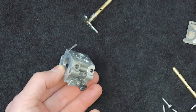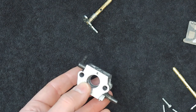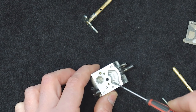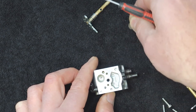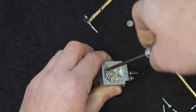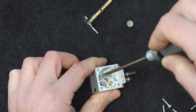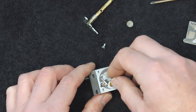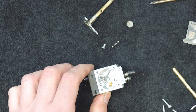What I'll do is bore these out and fit some bearings in there - I'll show you how I do it. Not sure if it's a DIY job but we'll see - you guys be the judge. We'll pull that inlet screen out using a small screwdriver - it comes out very easily, full of dirt and junk. Next we'll take the metering valve and lever out - it's just a Phillips head screw that holds it. There is a spring under there and a little shaft, so just be careful.